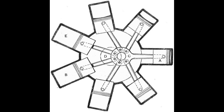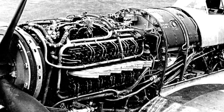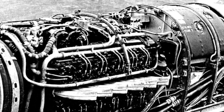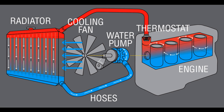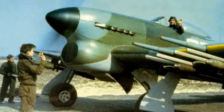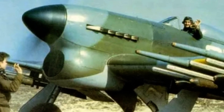Like the rotary, radial engines have fewer problems with cooling than all the inline types. With increases in power there are also corresponding increases in heat generation. With most inline types — whether straight, V's, H's, or X's — any cylinder further back than the front one will require some help in being cooled. This necessitates liquid cooling, using a circulating fluid to bring the waste heat from the engine to a radiator to get rid of it. This is added weight and complexity, and a cause for concern with combat aircraft where a single bullet in the system can be catastrophic.